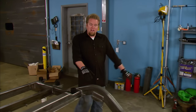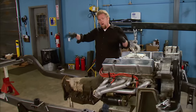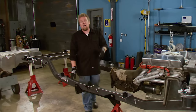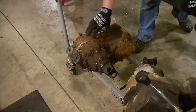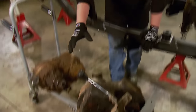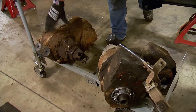We are right in the middle of putting together our 100% custom CJ8 Scrambler inside our small two-car garage. Originally we dropped the body on the frame to check for clearance against the back of the engine, and now we've pulled it back off to deal with the transfer cases as well as a cross member. When it comes to transfer cases, it was your choice as to what we use, and you guys made a great pick. The New Process 205 is possibly one of the strongest OEM cast iron all-gear transfer cases you can choose. There's always been one problem with this case: it only has a 1.96 to 1 low range ratio, which just isn't good enough for crawling. So here's the twist — we're going to install the range box off of a 203 transfer case, which will essentially double our low range ratio.